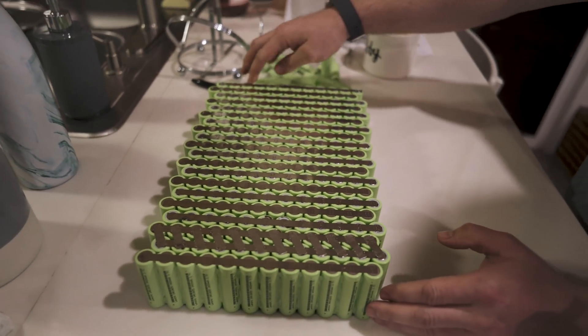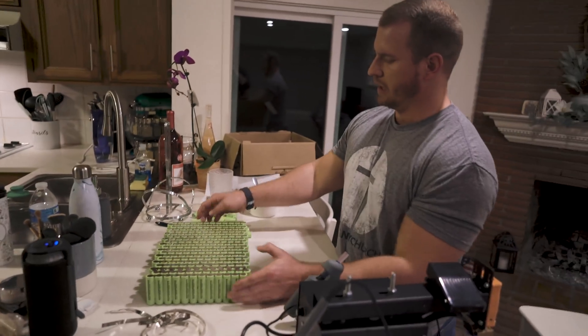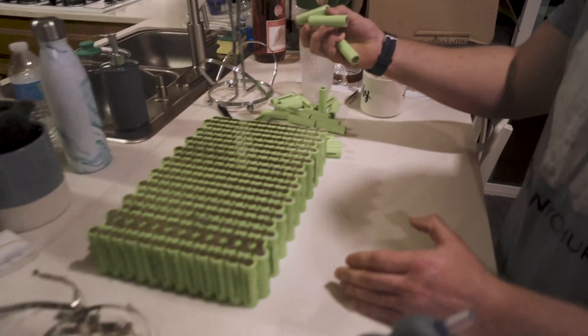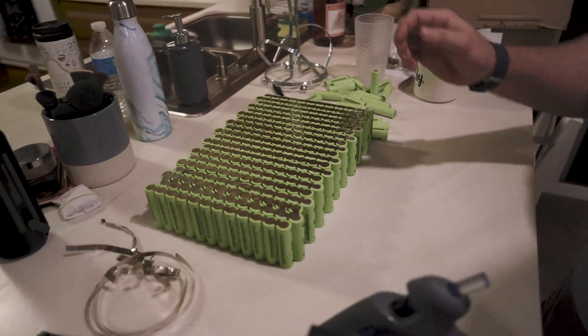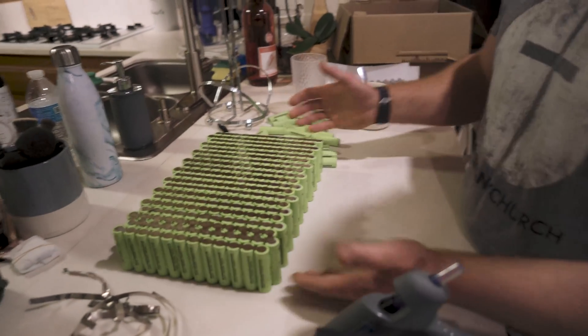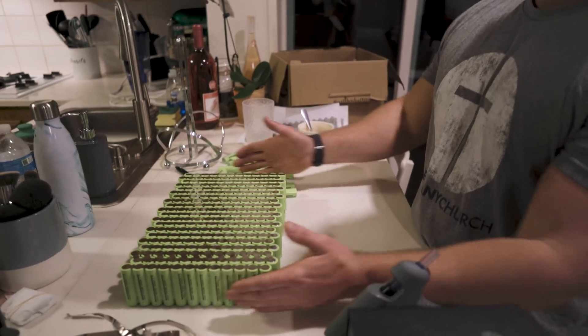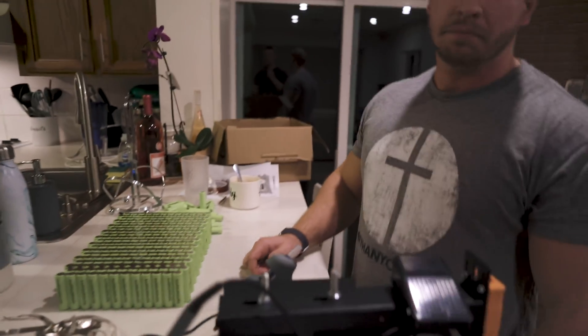All the batteries' voltage adds up basically, so it'll make 72 volts. We've got our backup batteries in, so we're going to add an extra row of parallel cells — it'll be 13P at 20S. That will increase range — it'll make it so it has more amp hours, which together with the voltage makes watt hours, which is your range.